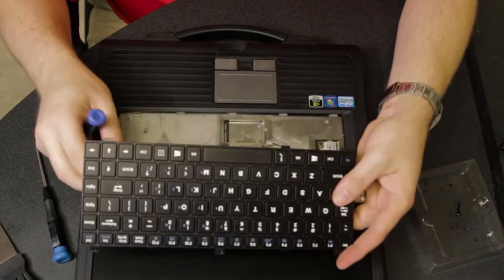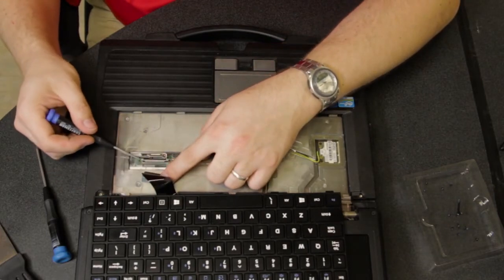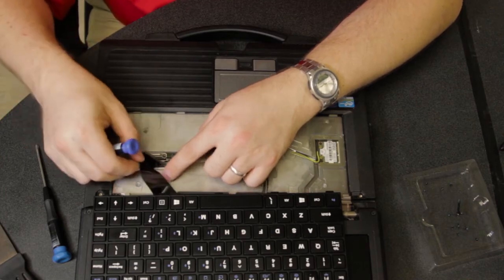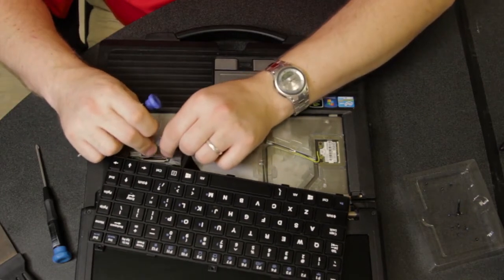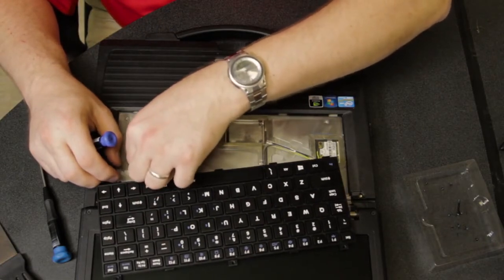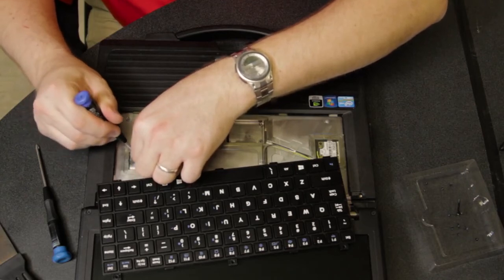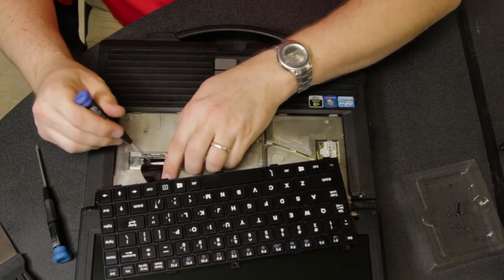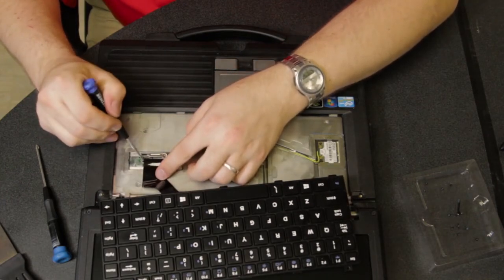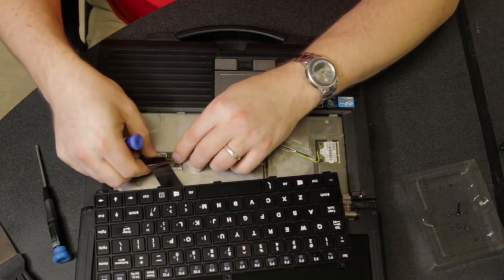There's nothing wrong with this one so I'm just going to go ahead and put it back in. For insertion of the ribbon cable, you do want to make sure that the knuckle is open before you try and put the ribbon cable in. You just push it right down into the slot, and then once it's inserted the whole way, you push down on both sides of the clamp at the same time. If you just push down on one, it will rock the other end back out again. So you do want to make sure you push on both.